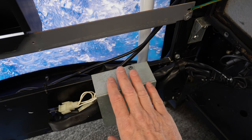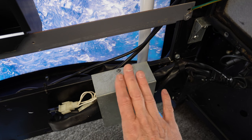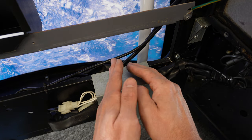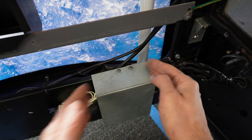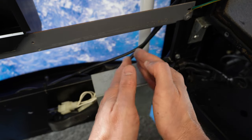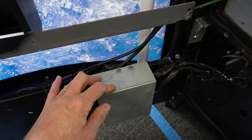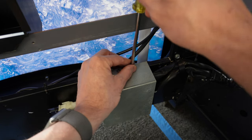This box is just covering up the plugs of the switches. There are actually two connections — a harness that goes from the door, and then a harness that goes up to the control board — so they've made a connection point here, meaning you don't have to replace the entire harness if it's bad. I always like to check these if I'm having issues with the sold-out switches. I'll just remove this box — you're going to need a Phillips head screwdriver.